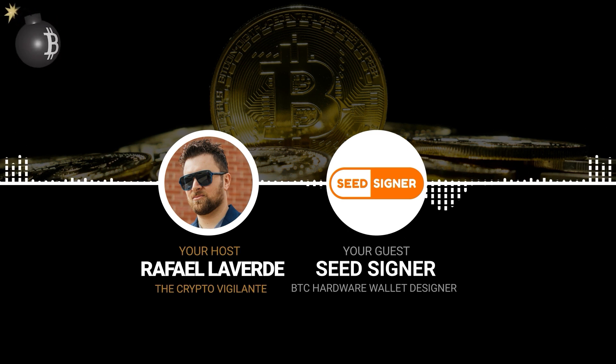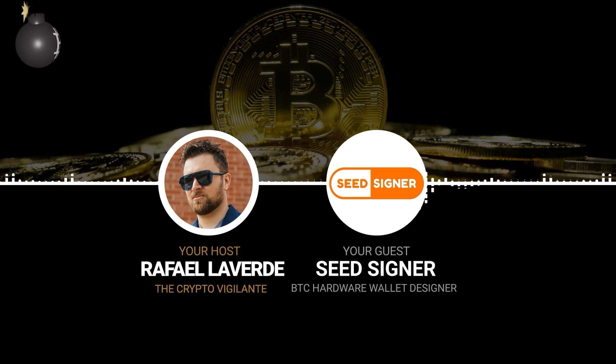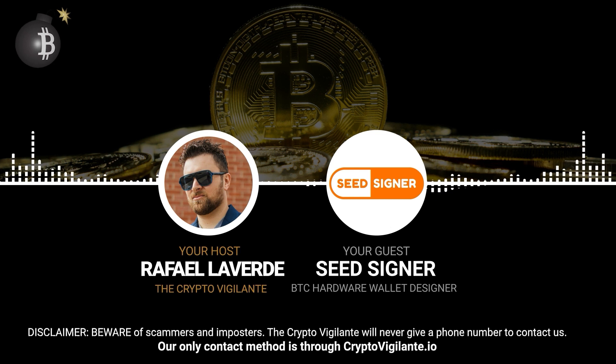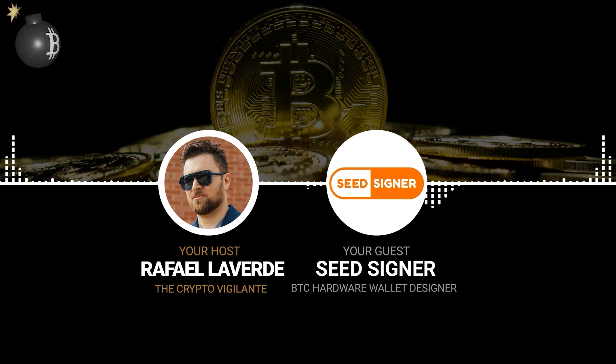My background is in digital forensics, and this was technologically kind of an outgrowth of techniques we use in that world. We use a very specific version of the Raspberry Pi Zero — a Zero version 1.3. What the 1.3 means is that it does not have any wireless Wi-Fi or Bluetooth hardware built into it, so it's naturally a very isolated, air-gapped little computer. The current incarnation of SeedSigner is Python code running on top of a stock Raspberry Pi OS. When keys are inputted into the device, we only maintain those as Python variables in memory. We take extra steps to make sure key data is not cached to the memory card running the device.